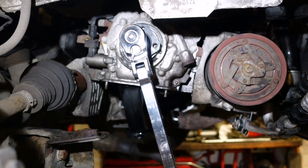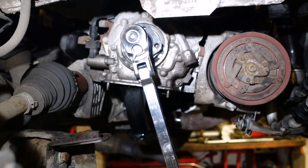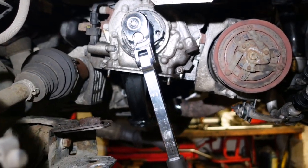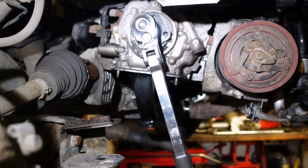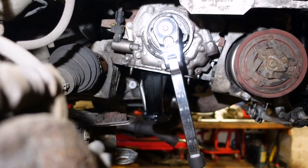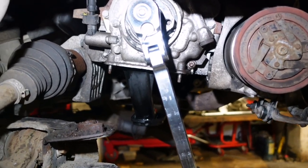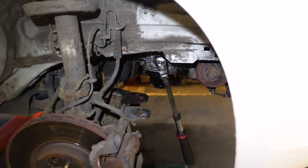When you're using those teeth for reference, that's the starter ring gear teeth. I'm just using that as a reference point, putting a wee tip-ex mark on it to see how much the flywheel had to move. The reason it seems a lot is that the crank has to rotate two times for every one rotation of the camshaft. So I have to move it a good bit to get the camshaft to move.